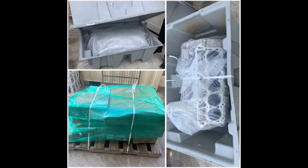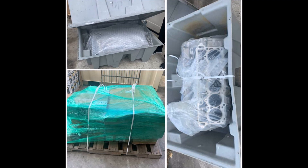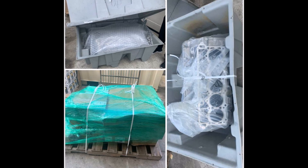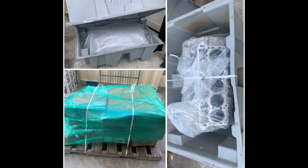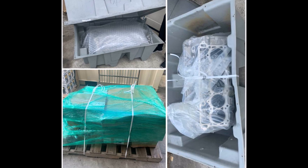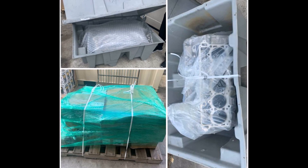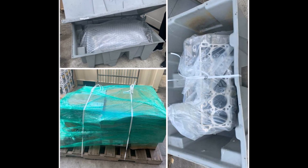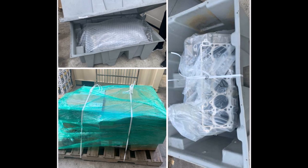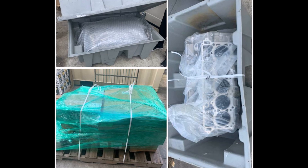From a desirability standpoint, if you can get a new Gen 4 block, they're much more desirable than Gen 5 because you don't have to worry about loose casting sand in an oil galley breaking off and wiping out a bearing. Once the new block was in hand, I had two options: rebuild back to stock OEM rotating assembly at stock displacement, or do the 9-liter build. I got quotes for both, and the spread financially just did not make sense to rebuild back to stock.